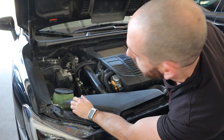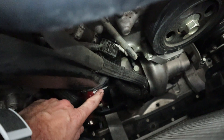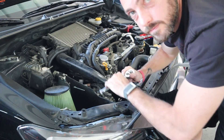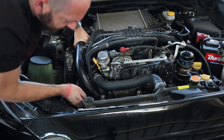Now we're in front of the car. Very first thing we need to do is take off our stupid modern car engine plastics. First thing we're going to do is take out the charge pipe, so we need to take that clamp off the intercooler nipple right here. The bottom of the charge pipe goes right there, that's where the other side connects. I'm using a little screwdriver to kind of pry the bypass valve loose.